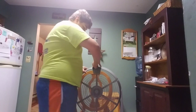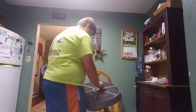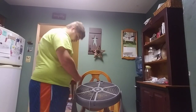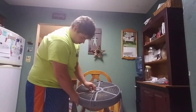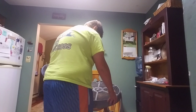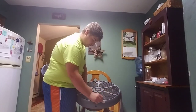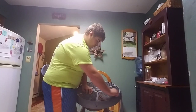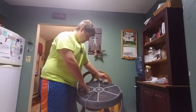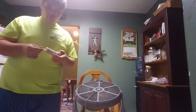The next step you want to do is go to the back of your fan and clean the back half of it as best you can. This one's got dust kind of entrapped in it — a lot of dirt and dust. Just wipe it down in a motion going toward the outer edges of the fan, and it will just trap it. Another way you can do this is with an air compressor, but I wouldn't recommend it with an Aerial Speed fan because of the material of the blades.